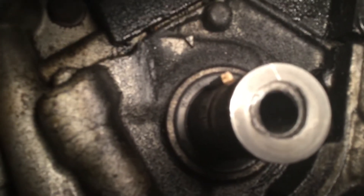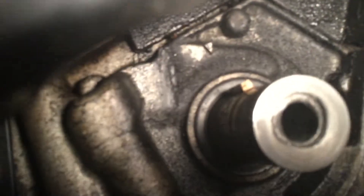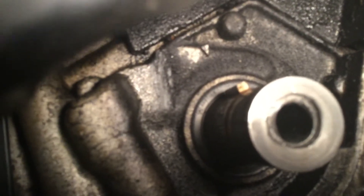That arrow right there near the center of the screen is the mark that you're going to see. And I stand corrected — that's not on the timing belt cover, that's actually on the oil pan. So that's the mark that you're going to line up with the edge of that timing gear sprocket when you get everything lined up.